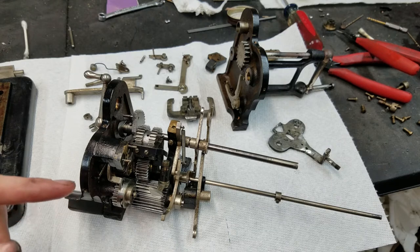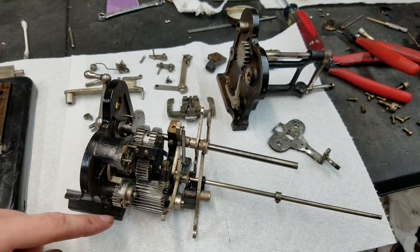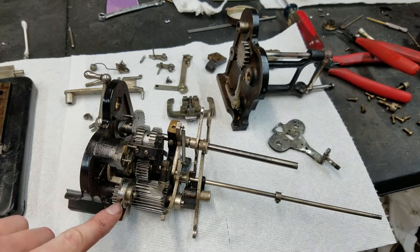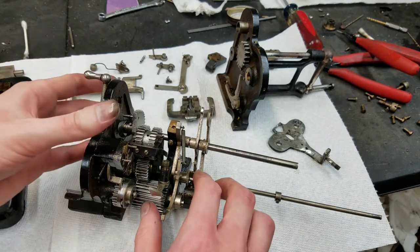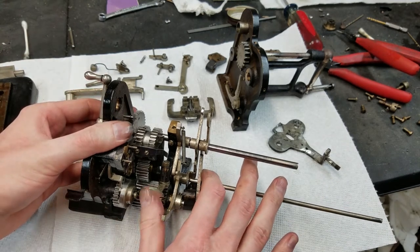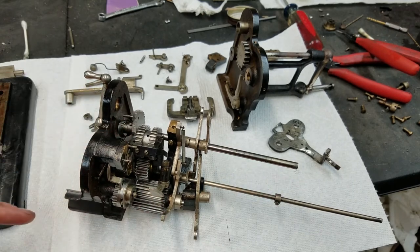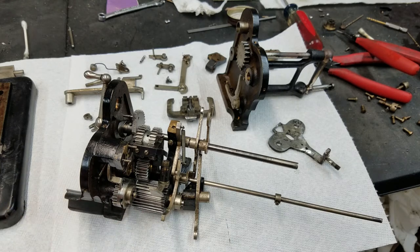But in the other scenario, if you turn the crank handle the other way, that fixed finger wouldn't increment until the very end. Now you don't have time to propagate all those carries across, and you won't have your carry propagation in the counter. So that's why they have two different fingers that retract or extend based on the direction, so that the finger always increments the counter at the very beginning of the cycle. If I go this way, it increments right there. If I go this way, it increments right there, and then it always has the entire rest of the cycle for this gear to drive the counter carry zone to propagate all the carries across.